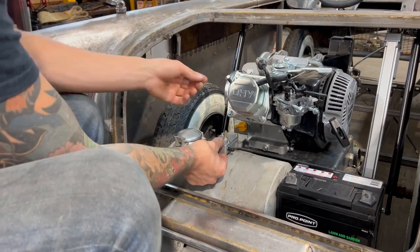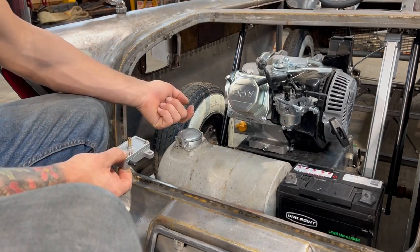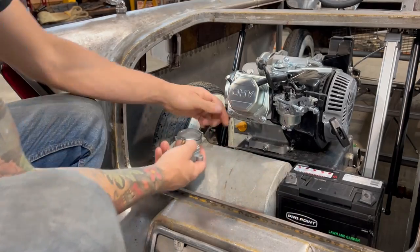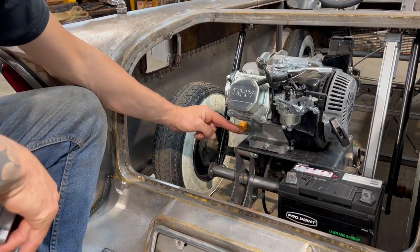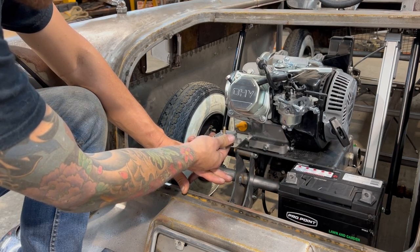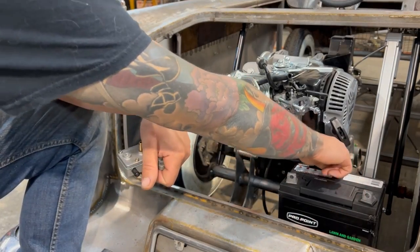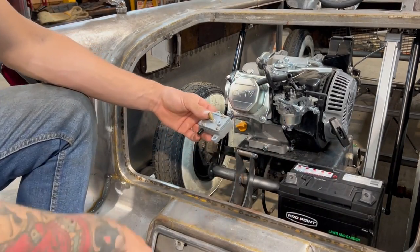I'd like to put it right here. This is kind of the closest to both fittings. Directly under this cap on the bottom side is the fuel fitting. So what I'm thinking of for the gas tank and the battery box, like I said before, is gonna be some kind of strap situation. And I've got this round DOM tubing that can pivot a little bit. So I was thinking I'll make some kind of strap over the top that also has the vacuum pump on it. I like making brackets that you can kind of get two things done with one bracket. And then I've got a couple of wing nuts. I think it'd be cool if I could wing nut it, maybe a wing nut over here, same type of idea, like a strap that comes across with maybe a wing nut. You know, that's what I'm thinking. So I'm gonna go ahead and draw that up and get it on.